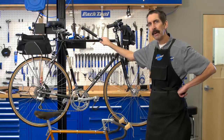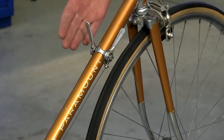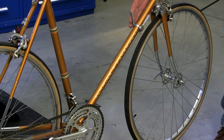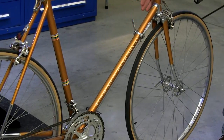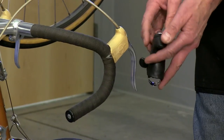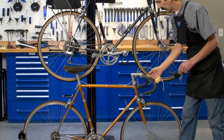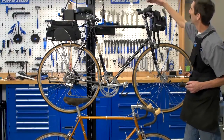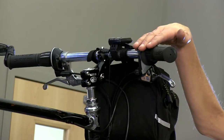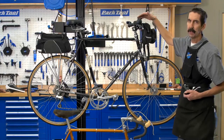Let's have a look at some of the things you might do to keep going. Originally, the racer would have had the down tube shifters, reaching down to make your shift — nice for a young guy, but as you age you want to come more upright. Replacing these levers with the index shifter, the early Sachs models. The transition after this is getting rid of the drop bars entirely, going to the flat bar, and in addition, a taller stem. So now we are quite a bit up, with index shifting — a much more comfortable position as we go through life.